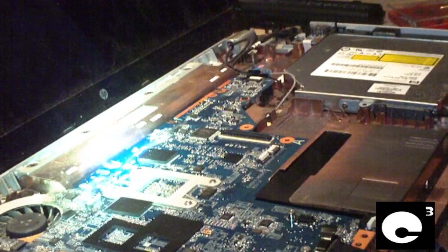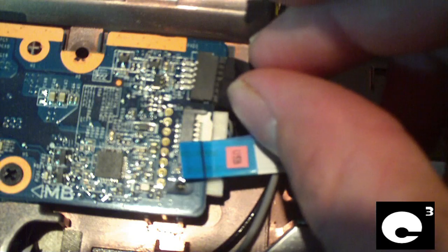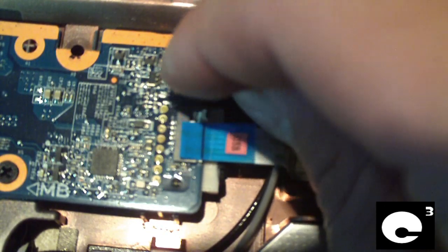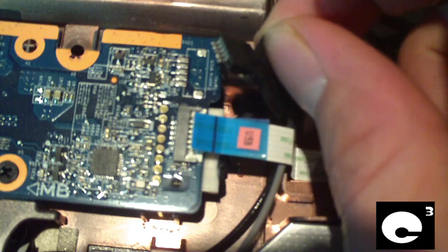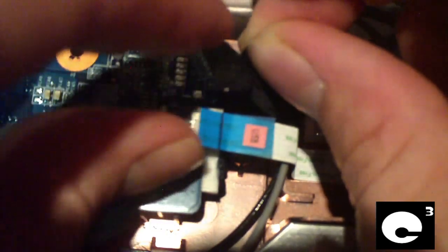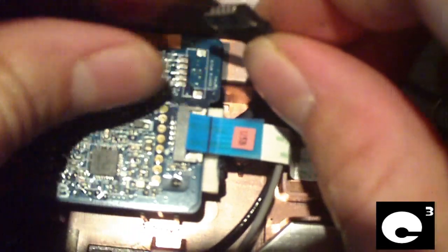You're kidding me, right? Well, okay, here's a fine example of HP's very shoddy engineering. I want to remove this cable here, barely pulling any pressure at all on it, and the whole solder joint is popped loose. So now this connector is just broke loose from the motherboard. So what I'm going to do is take the whole motherboard out and take it out to the garage, use the heat gun to reflow solder this connector back in place. Ridiculous.